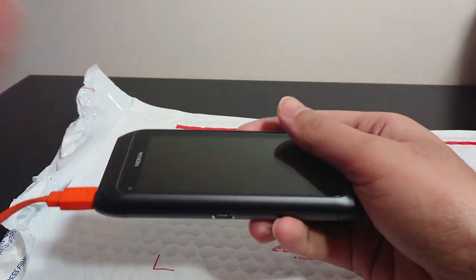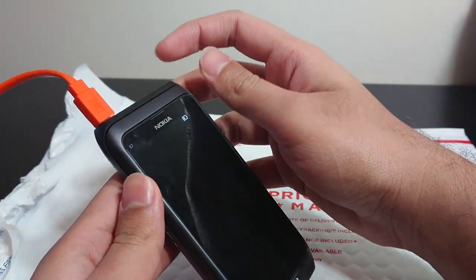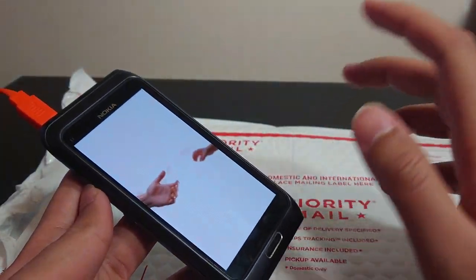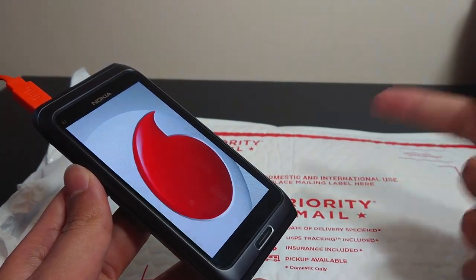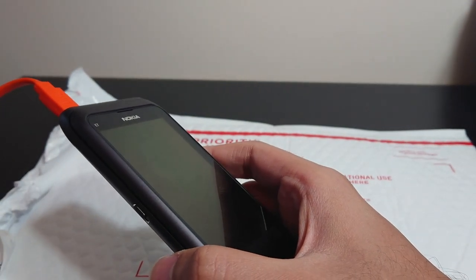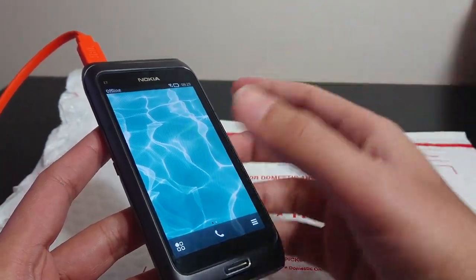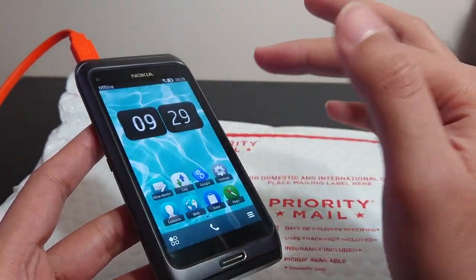So the phone eventually did power on and I played with it for a while, then turned it off again so it can charge. Let's turn it on again. While it turns on, I want to discuss — I saw this loading issue before and thought it might be the EMMC issue. One of my subscribers and an active member on my Discord server suggested it might be the EMMC, AKA the memory module on the phone, that causes that. Some Nokias do have that problem — you get the six dots blinking and the phone never turns on.